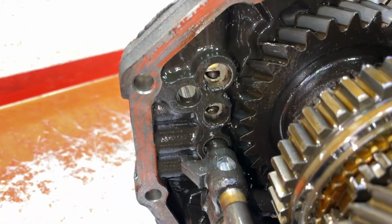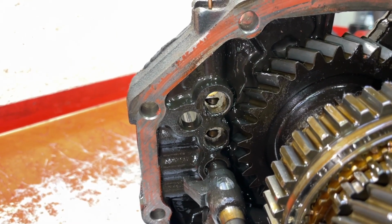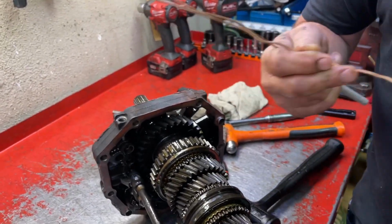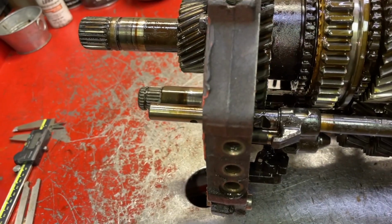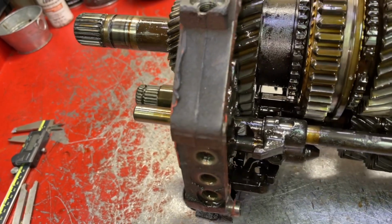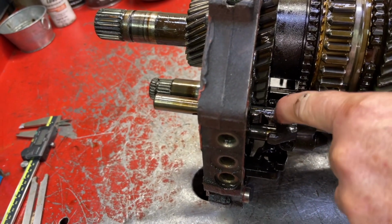Okay. So there's another little ball down there he's gonna remove with the magnet? It's the same as the last interlock. Same dimensions. Okay. So there's another snap ring right here. When reverse is engaged, I have reverse pulled out over here. You can't move that rod. That snap ring stopper is up against it.